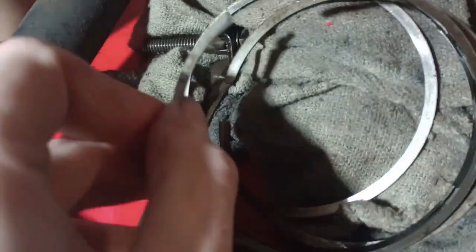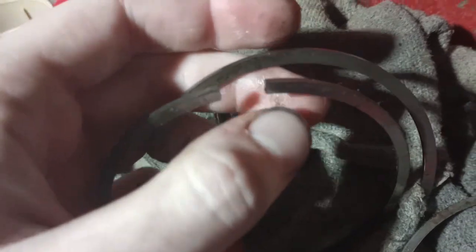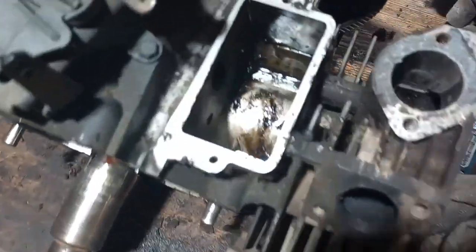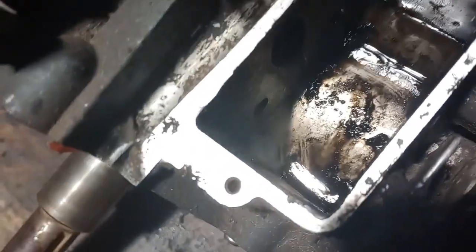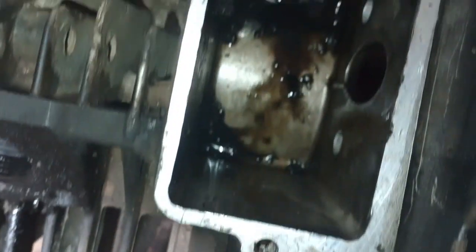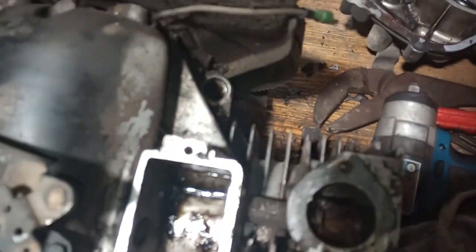These compression rings are shot. When I stick them in the cylinder there's like a quarter-inch gap. When I pulled these valve covers off, there was oil sitting all the way up to the valve stem. I wondered why - they usually have a drain hole. And yeah, there is a drain hole, but that little black speck is the end of it and it's plumb stopped up with sludge on both sides. So yeah, this thing needs to be cleaned.